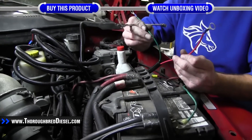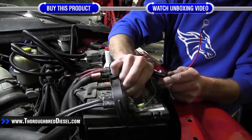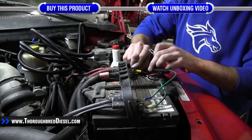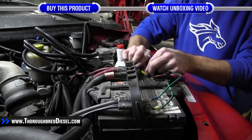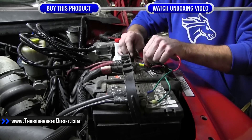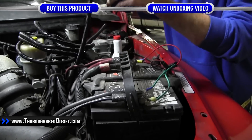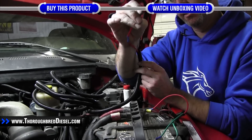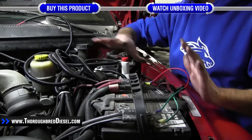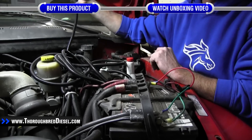We're going to connect our constant power source using a half-inch wrench to loosen the nuts on the battery terminals. Connect the green wire to the ground and the red wire to the positive side. This will leave us with one connection remaining after the constant power connection — the key-on power source. We'll tighten up the battery connections, clean up the wiring harness, and zip tie it down the frame rail, then move inside the cab.